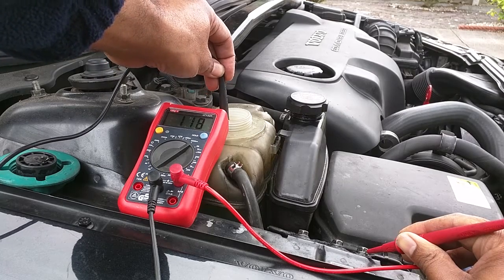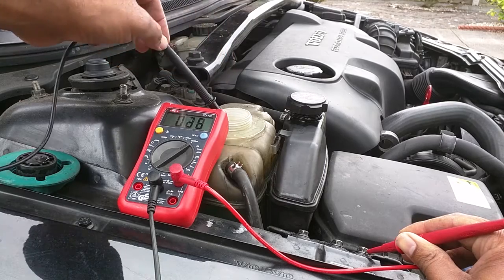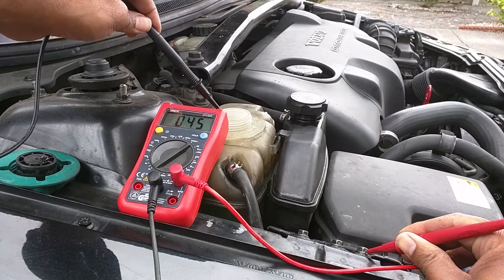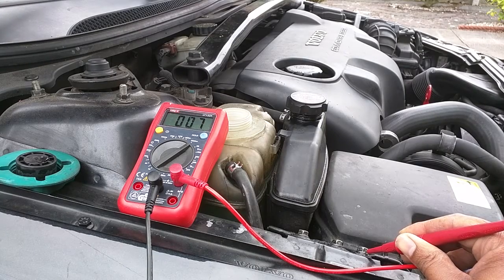As a result, the coolant is showing very little voltage — certainly a lot less than the 200 to 250 millivolts maximum. If your coolant is showing over 250 millivolts, just get it changed out, get the old coolant flushed out, get a new good quality high-strength coolant in there and jobs are good. That's the conclusion showing the effect after a coolant change — very quick, very simple tests to ensure your coolant is still effective. Hope you find that useful, thanks for watching.